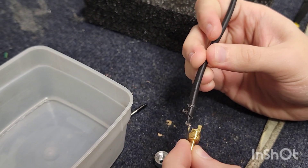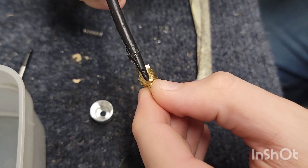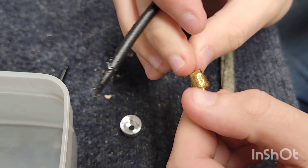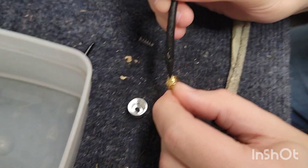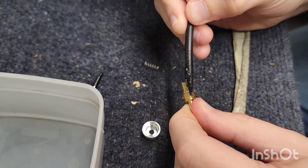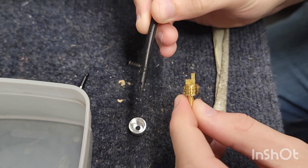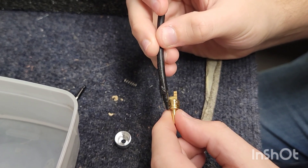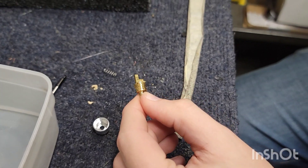That's how you can add and remove the lubrication on the inside of the piston. That's where it's going — obviously if there's more fluid it's going to be slower, and if there's less it's going to go down faster. As far as what the correct way is, it really comes down to you, because when we've made it really slow people felt it was too slow, and vice versa. Being able to adjust that drop speed is always a nice thing to be able to do.